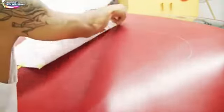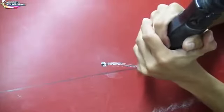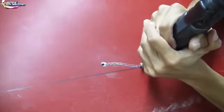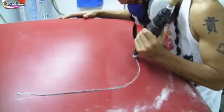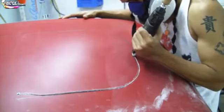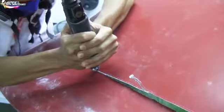I'll remove the paper, finish tracing, then drill a 3/8-inch hole so I can fit my blade in and start cutting all the way around with the jigsaw. This is fiberglass so it was pretty easy. I did this once on a 67 Camaro — same process, you just use a metal-tip blade.